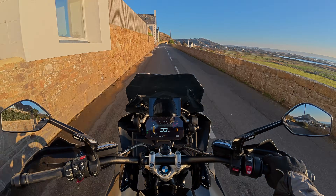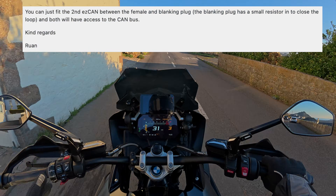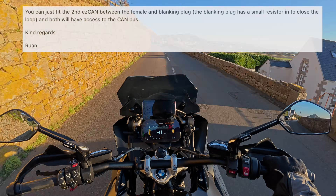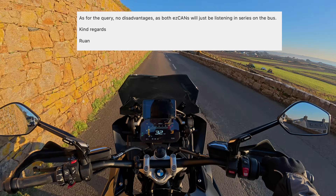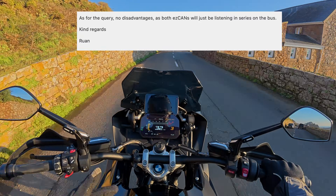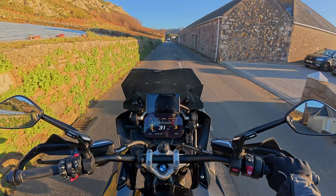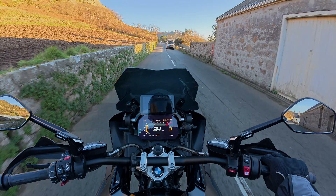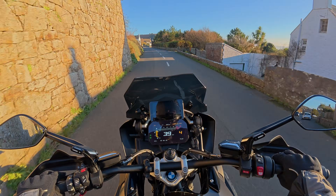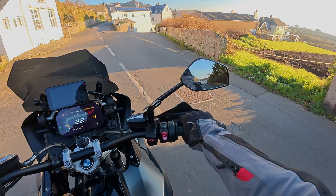I just like the way it integrates and it's all very tidy. You've just got to be careful with the amperage as we've spoken about. I emailed Hex — I think they're in the United States — and within half an hour they got back to me. I said I've got 32.5 amps, looking at getting another Hex Easy Can for accessories so we don't go over the 30 or 25 amps. They said yeah, you can daisy chain it, which is what my question was. So I'm going to do a video at a later date on how to daisy chain the Hex Easy Cans — you can do it, no problem at all with the Generation Two Hex Easy Can. That's only really an issue if you've got a Denali Soundbomb knocking out 20 amps when you press the horn button.